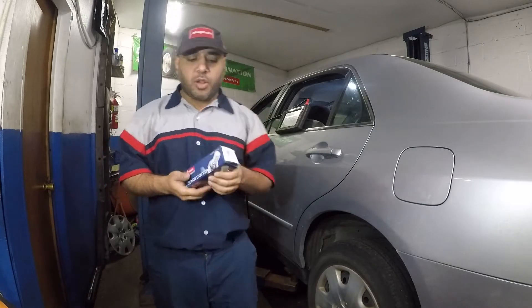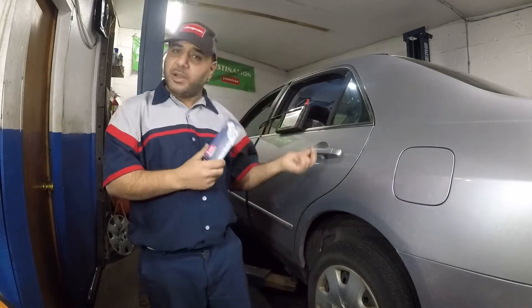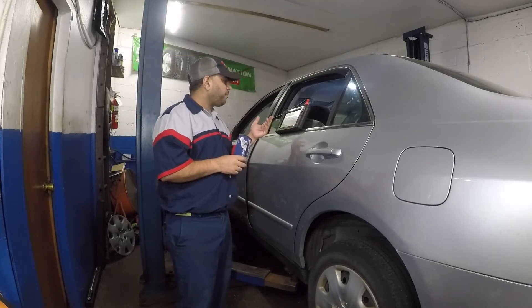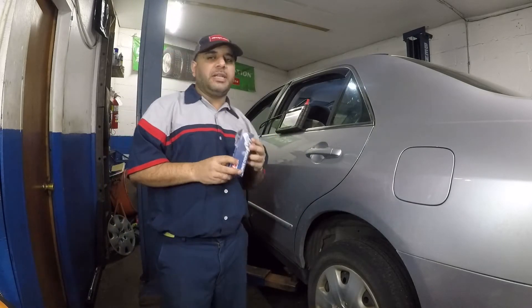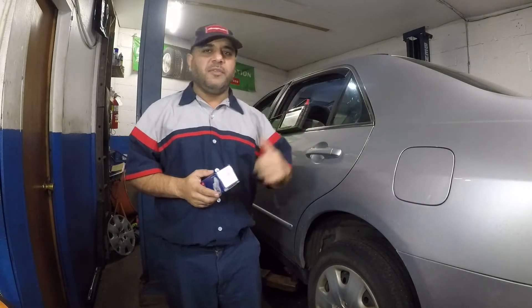So it's giving us a slow response — not a circuit issue or anything else. I did replace a sensor on this previously; maybe it was a bad sensor. It's also giving a lean and rich code, which could be a vacuum leak or something else, but I warrantied the customer so I have to replace it again. I didn't make a video last time, so this time I am.